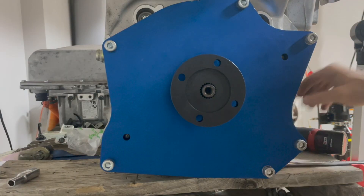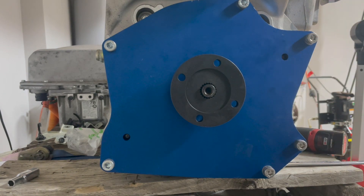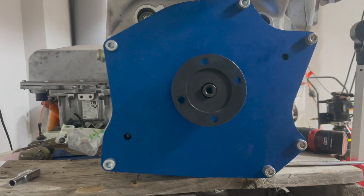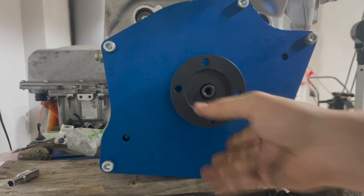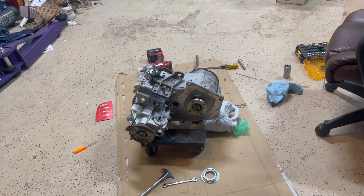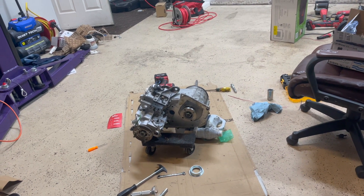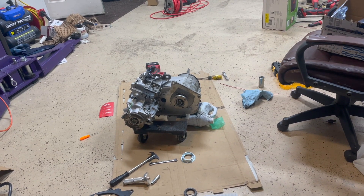The thing I forgot to mention was putting a little bit of grease on here first - I didn't get that on camera, but it just kind of gives it a hold on the face. Now I've got a 1310 flange on the back of the electric motor, and I've also got a 1310 flange on the input of the transfer case. So hopefully I can get the cab off and start getting these positioned so that I can have some drive shafts made, maybe get a resolver controller in here and see if we can make it move. Thanks.